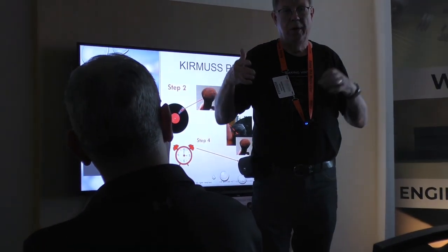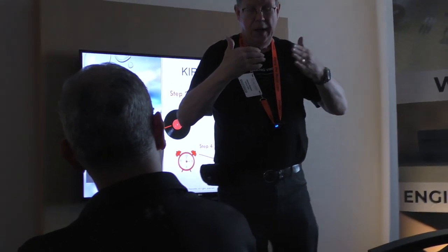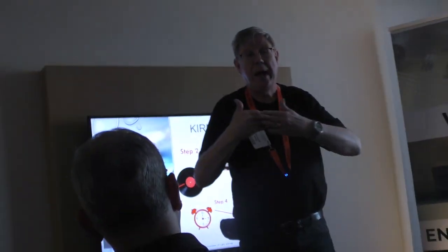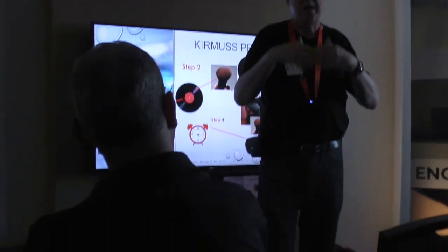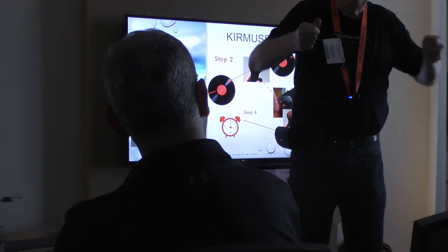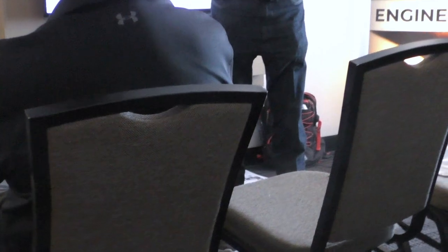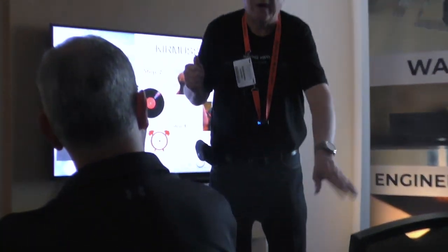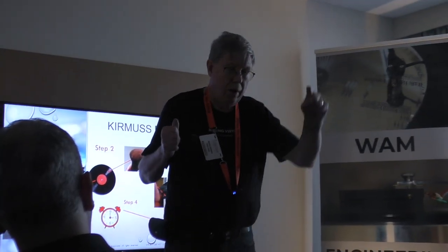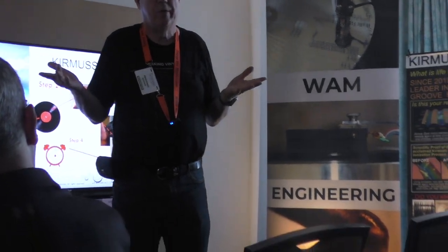Degassing is important. Every time you put a record in an ultrasonic bath, it introduces air, and air is the enemy of creating bubbles in an ultrasonic by those transducers. So I remove the cover every 5 records and take a look inside. Oh, it's not milky. That's fine. There's some fungus or whatever maybe stuck on the bottom. I do the degas. That's when I inspect whether I really want to change the water or not.